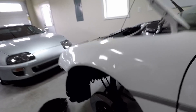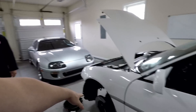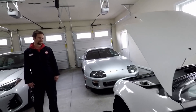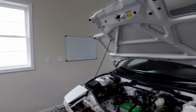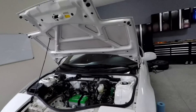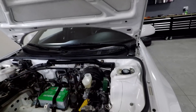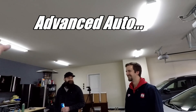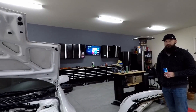The car looks good and I'm happy to have the brake master cylinder on. I still need to bleed the brakes, and I did get the clips off the front bumper — so that's all done. The brakes are bled now, thanks to help from Alex here. So brakes are all good — '96 Land Cruiser master cylinder is what we used. Next up we're going to go test drive. There's not much else to do today but go have fun.